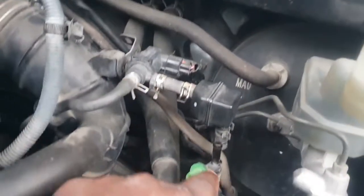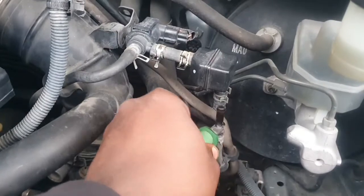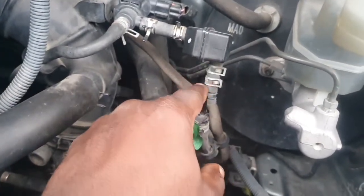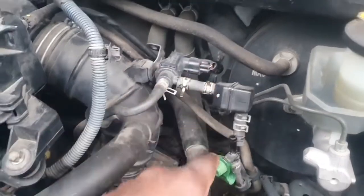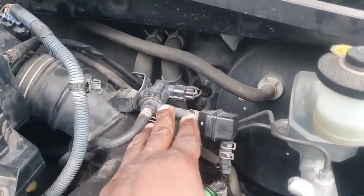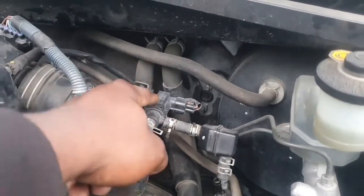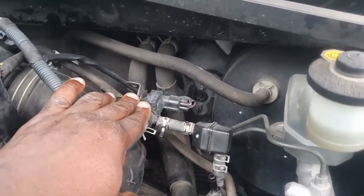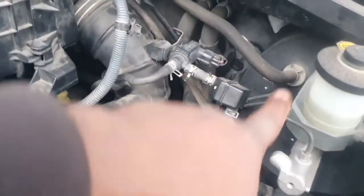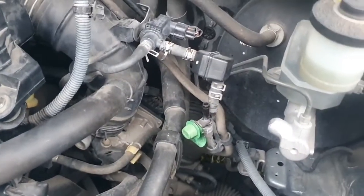Here is the valve — it has an electrical connection. This is your normal valve that you can open, but you can just bypass it. This is a 2005 RAV4 as an example; most vehicles have this. You can pull off any one of these hoses before the actual purge valve. The first test with the key off is to send smoke in and see if you see any leakage. You shouldn't have any — it should be tight, completely closed with the key off. That's one of the main tests. Then you send smoke down through the hoses all the way to your gas tank, and it ends at your gas cap, where you can test for leaks in that area.